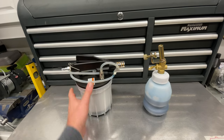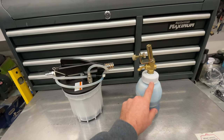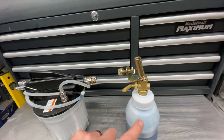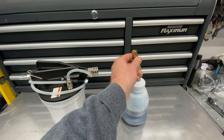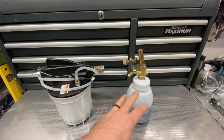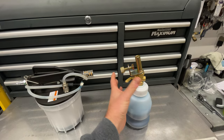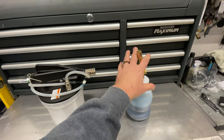So let's do the review on this tool now. As a set, the reservoir jug — other than being a nice container — it's not super great. I think the design is meant to let air in so it can keep the reservoir full when you open the valve, but what ends up happening is if the tube is sitting in the liquid, it won't drain. The fluid just sits there. It doesn't work unless you lift it upside down and pour it in. So it's a nice little container to pour from, but as far as clamping it on, it didn't do great. I wouldn't worry about whether this is in the package or not — you don't need it.